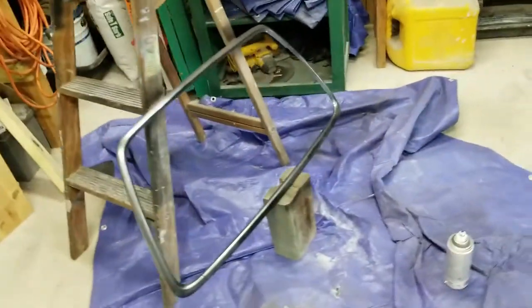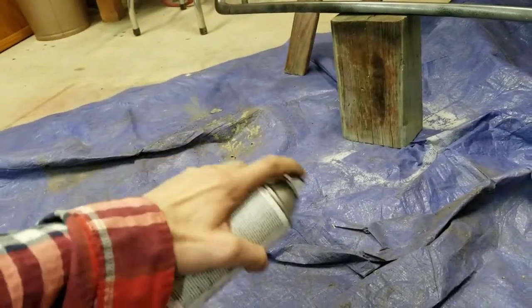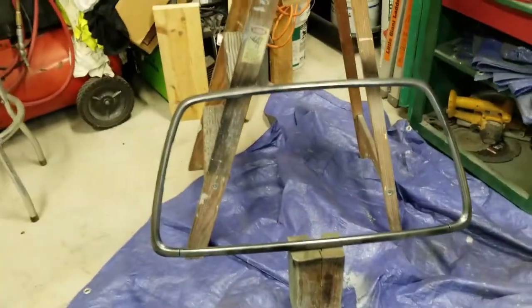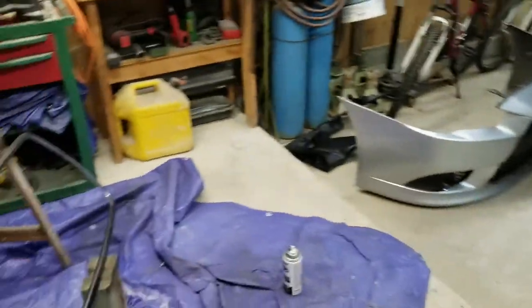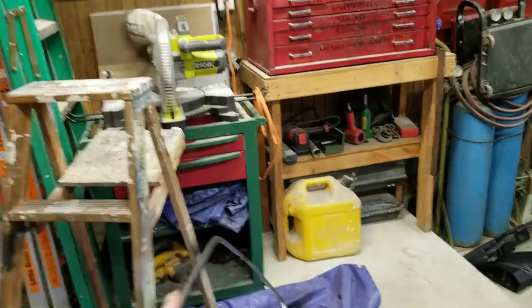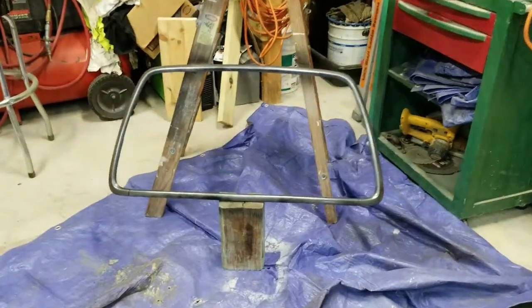Here's kinda the little setup. Most people don't realize it, but spray cans are not designed to spray this way. Doing it on the ground would probably get splatters in it. So you wanna paint as vertically as possible when you're doing it with a spray can. It's like when a lot of people try to dip their hoods — you wanna take it off and prop it up against a wall rather than spraying down at your hood. It's a spray can, so it's not gonna be awesome, but yeah, there's the little setup.